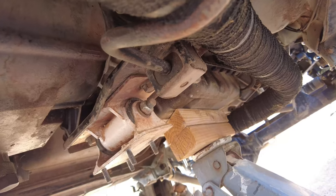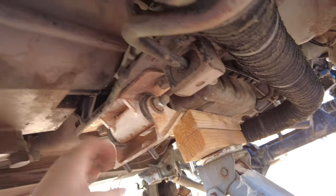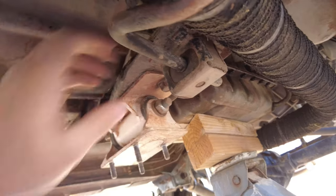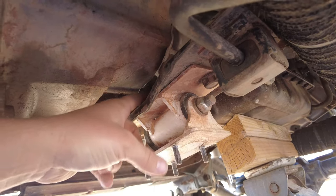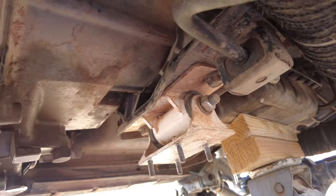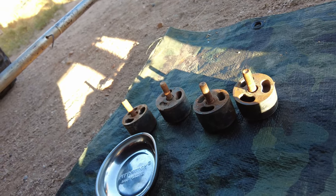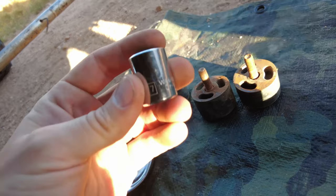My plan from there was to remove the bolts for the transmission mount and then put a jack underneath the transmission pan with a block of wood to hold it all in place while I wrench on the transfer case. Then once you remove the cross member, you're going to want to undo the breather hose and all of the electrical plug-ins and connections on the transfer case. After removing your cross member, remove your transmission mount and then your exhaust mount — that should give you access to all six bolts holding the transfer case to the transmission. The bolts that hold up your cross member are a 17 millimeter.